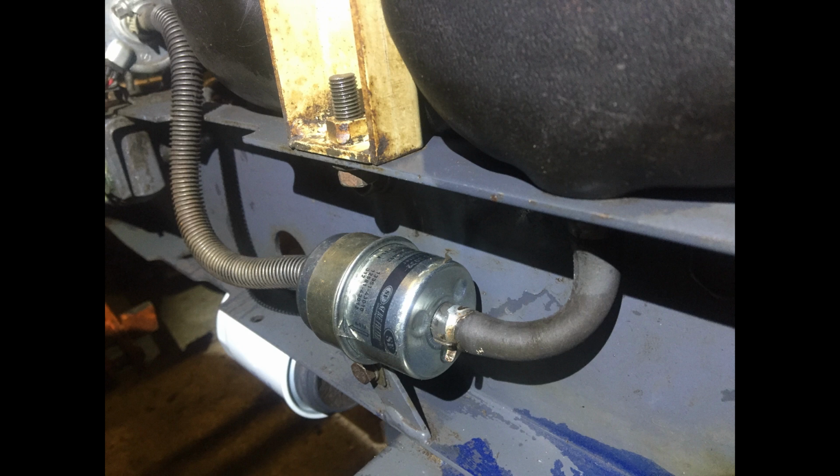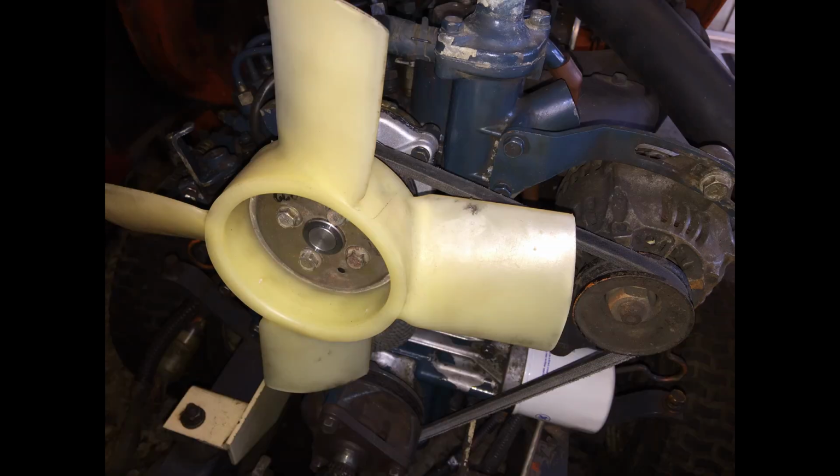It gets a bit more complicated if you want to change the fuel filter, the one that's placed near the fuel tank, because you need to remove the rear left wheel to reach it. Additionally, the water pump and alternator belt change could also seem complicated because you have to remove the drive shaft and the radiator fan. Other than that, it's fairly easy to get the job done.